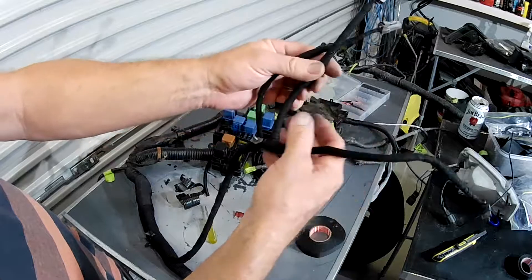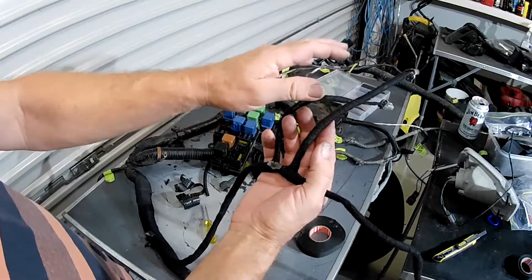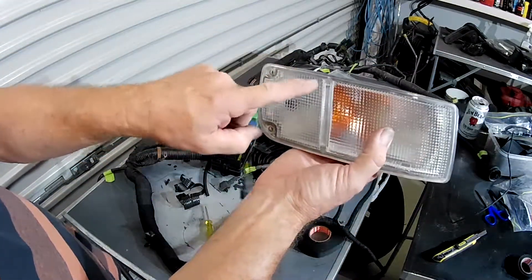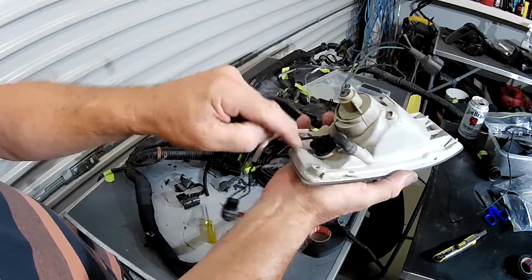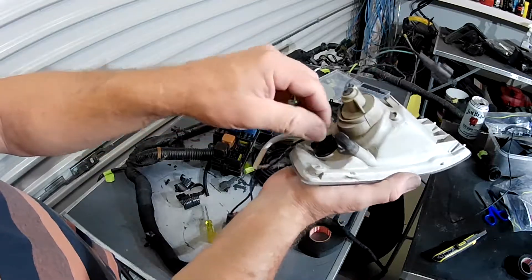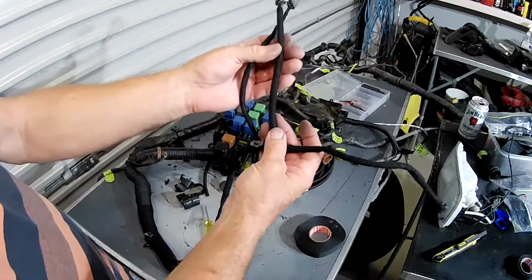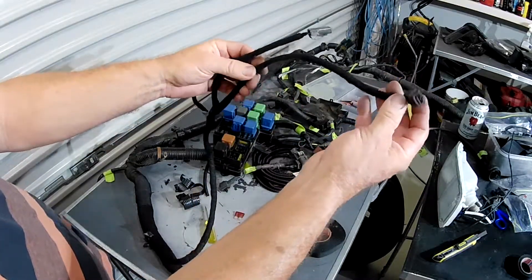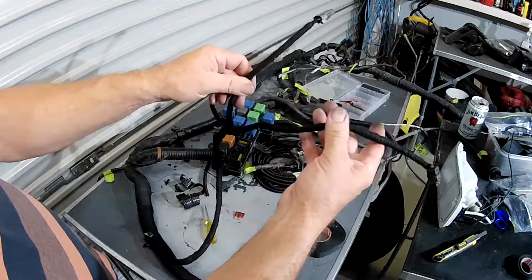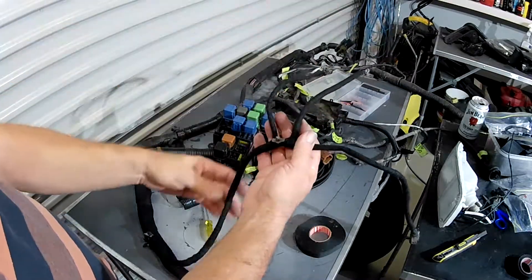Working my way along nicely. I've moved a couple of things — I'm getting rid of the fog lights on the front and moving the parking light in with the blinker. I've drilled a hole through the back here into that area. This unit that normally sits in your fog light is the parking light section, so I've taken it out, drilled this, and fitted it in. The wiring loom is going to be slightly different — I've separated the parking light wire which normally came out with the horn wire. These two were in a sleeve together, so I've reconfigured this so it'll work well in there.